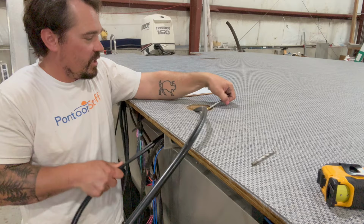It's just not happening. Before you put your deck trim on, the stuff that's gonna cover up this edge, you've gotta get your wires run and your hardware in that needs to go in, because once those are on, the railings bolt on top of those, there's no accessing stuff easily underneath the boat. Here's what I do, and Lowe Pontoons did this too, a lot of their older boats, JC, there's a couple other brands that did the U-shaped pontoons. I'm gonna show you my trick right now of what I do on these.